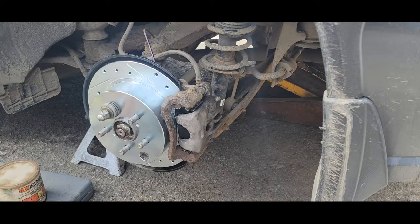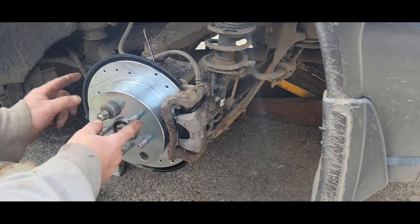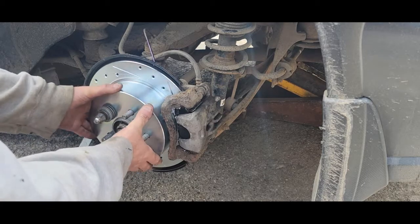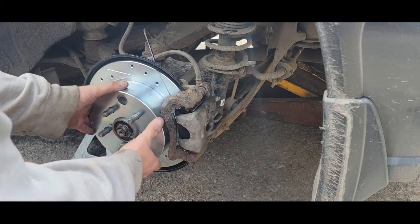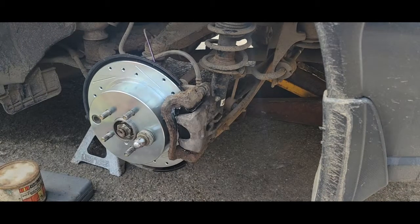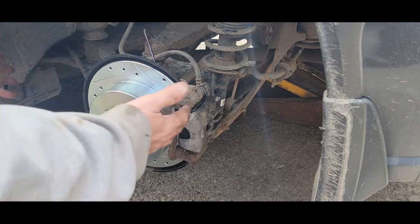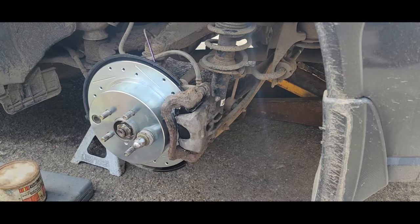What I did is put several washers on and put the acorn nut back on — just one nut draws that up tight. See how even that is — that ensures the drum is seated all the way in. I want to pull the emergency brake and see how many clicks. I usually like about four clicks — you don't want it to drag. I feel tension. I don't think I'm going to adjust any tighter because when parts are too tight they rust and can't move. Three clicks — it's perfect.